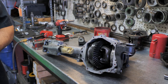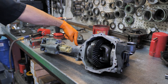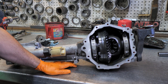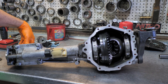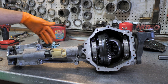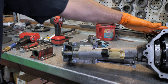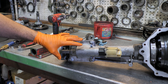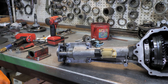Here we have a front end out of a late model Colorado. How do you get the axle shaft out of the front end? It looks fairly simple — there's a bolt here, there's a bolt in the back in the same spot. It looks like all you have to do is pull these bolts out and the tube will slide out. That's not the case; that's not how you take these apart. The axle actually has to come out of the end of the housing — the arm stays in the housing. What we're going to show you today is how to disassemble the four-wheel drive actuator and all the stuff inside and pull the axle shaft out.